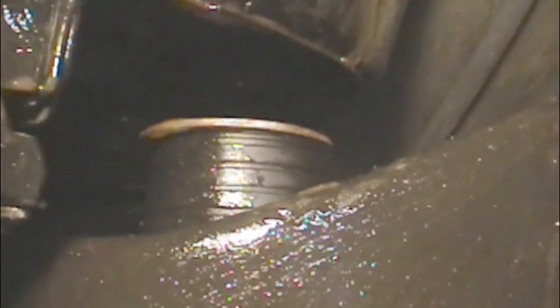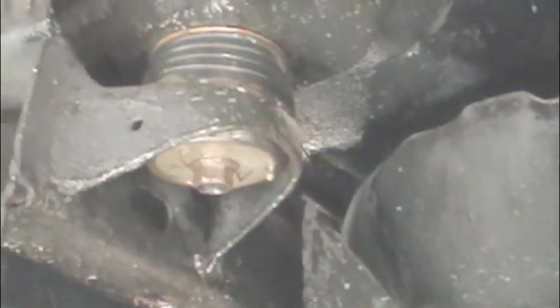Note to self — don't be complacent, pay attention. There would be behind the right front tire, or position two. Read your instructions, because if you're not careful you'll screw it up. Position three is different than all the others — the drop nut has a sleeved washer on it already, and you can see them way up there. The arrangements are different, so pay particular note and just follow the diagram. All are dropped in here and ready to go. Six and seven — now we lay the car down on the mounts and torque them down.